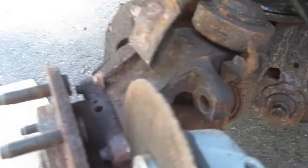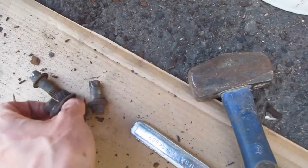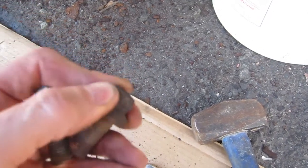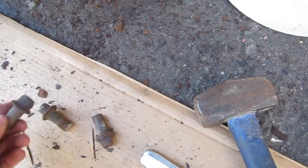Here's the work zone — notice these hub bolts are cut. I had to take the grinder and go in and cut them. All four bolts had to be cut. The ends are still sticking out. The grinder went in like so. The bottom ones were a pain — I had to do two slots and chisel one open just to get the grinder in. These were 12-pointers and they had nothing left on them. They were about 16 to 18 millimeter when I started and I'm all the way down to 13 just to get a bite to pull them out.